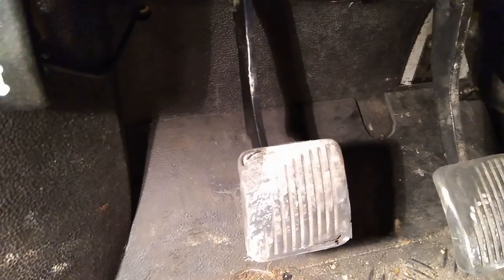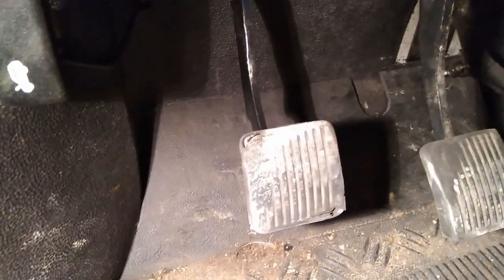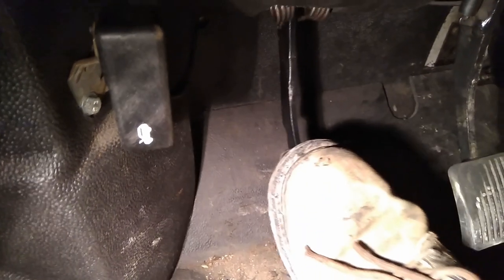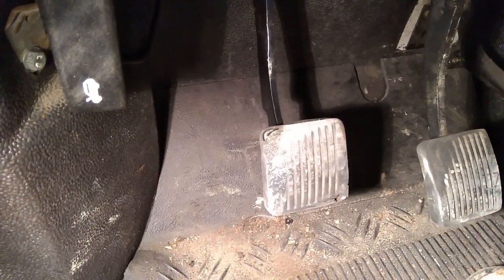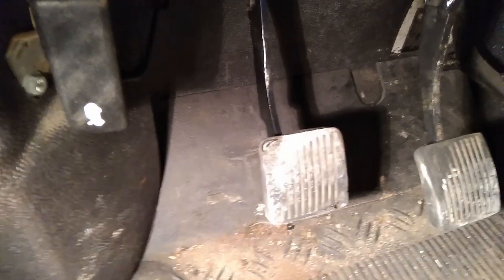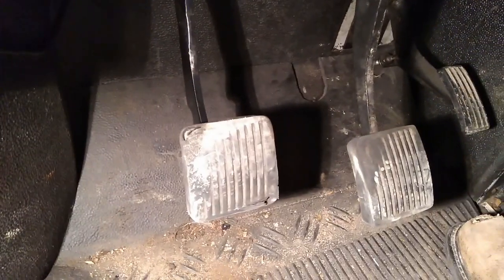The bleeding is quite straightforward — I didn't show that because there's tons of places you can see how it's done. This clutch is now very positive. I don't know if it's because it's a genuine master cylinder or just totally well adjusted, but this feels a lot better than the old one. There were times when you'd press the pedal and it felt like there was a delayed reaction from the clutch actually disengaging — so that was probably the master cylinder failing. This just feels great. The biting point is around about there, so you've got loads of pedal travel after that. I'm very pleased with that.